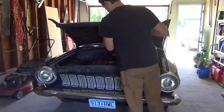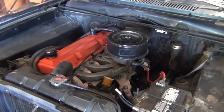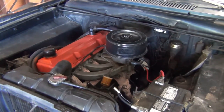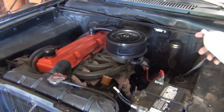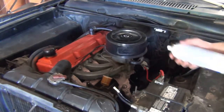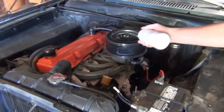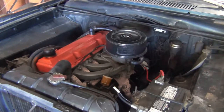So I'll show you what I'm talking about. After a while it's gonna start wanting to quit once that fast idle cam is done working. I'll spray some carb cleaner on the number two runner — it should pick the idle right back up, and that tells us where our leak is.